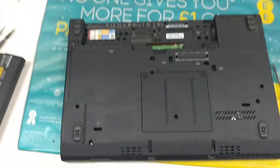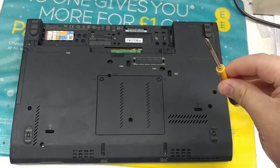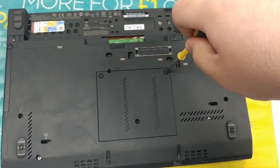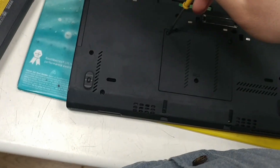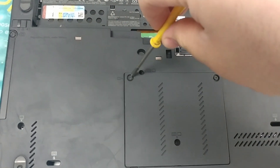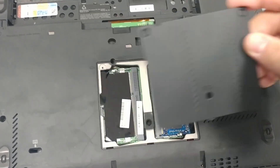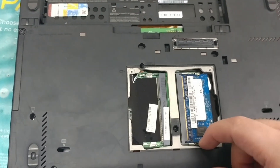To open the access panel you're just going to need a standard 3.5mm Phillips head screwdriver. I'm going to start with the RAM. Simply unscrew this and move to the next one. You only need to undo these top two screws — this and this — as it holds the keyboard, you don't need to do the others.